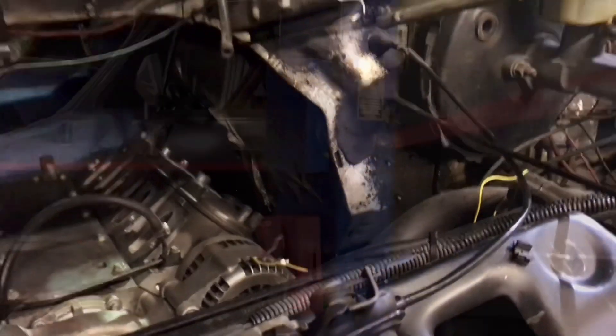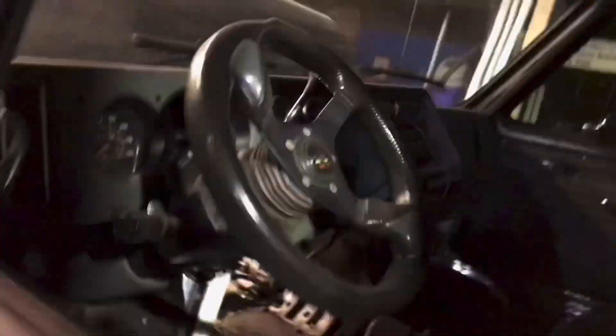There's also a lot of wiring missing. The other problem is going to be gauges, because none of that's going to work with a modern LS engine. It's a speedometer-cable-type system and we're going to need an electronic speedometer. A fuel gauge would be nice too.